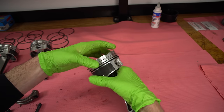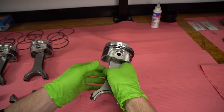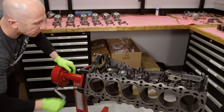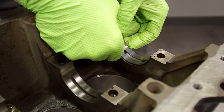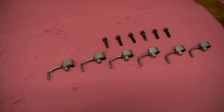I also like to number all of my pistons and mark which direction they're going to be installed into the block. I really like to double and triple check everything in an engine. Now the pistons and rods are ready to go in, so I'm gonna flip the engine over and put the crankshaft in. We've already checked all of the main bearing clearances, made sure everything is super clean, and we'll go ahead and install all the bearings.